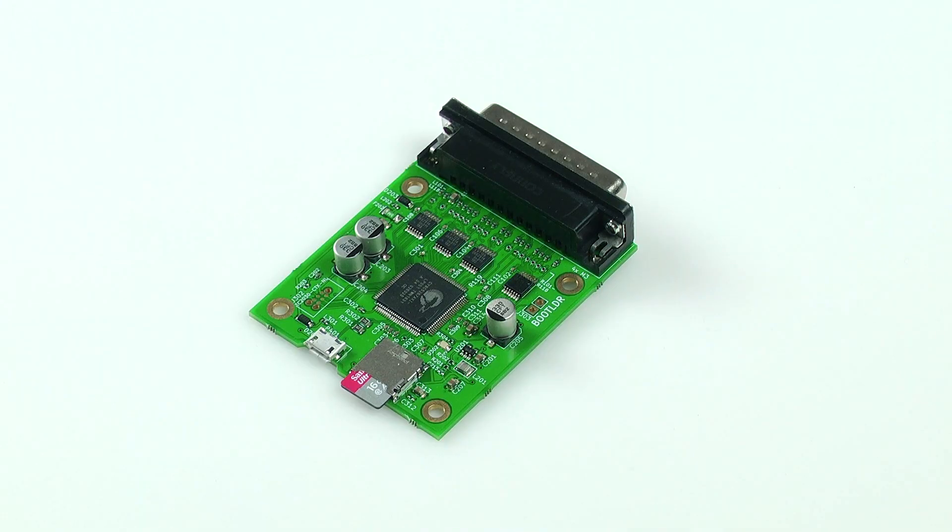The version 5.5 is very purpose-specific and comes as a standalone item with a plastic case. The case has been 3D printed — not particularly well, but it is quite sturdy and serves its purpose. The version 5.5 is designed to be used only as an external drive and can plug straight into the external SCSI port. It uses a micro SD slot like the version 5 but has software configurable SCSI termination the same as the version 5.1. It's much smaller than any of the others. I have it set up with a bootable System 7.1 partition loaded up with all the different system enablers that allow me to boot on any Mac from the SE all the way up to the early Quadras — basically any computer that will run System 7.1.